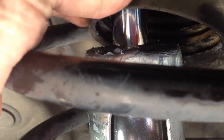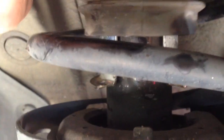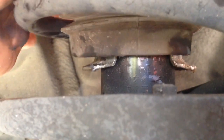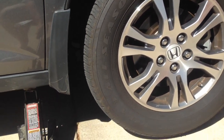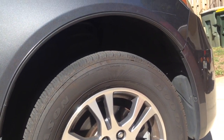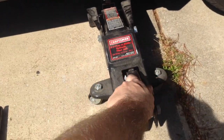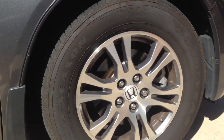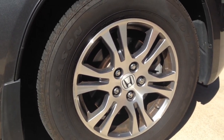I've applied the grease all the way around the top surface of the damping piece. Now I'm reinstalling the boot by sliding it back down — the little lips go just around the boot and it's reattached. Lower the vehicle carefully, easing the pressure off the jack so you're not dropping all the weight at once. Pull out the jack and repeat the same process on the driver's side front — and that's it, no more popping.